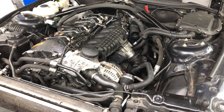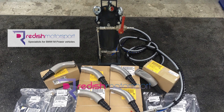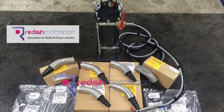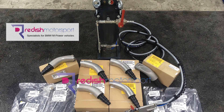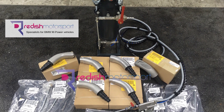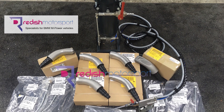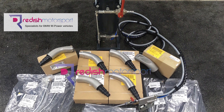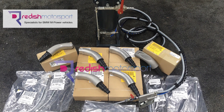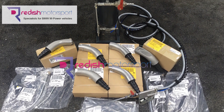We've got the complete tool set — the BMW hopper and all the correct adapters, the vacuum adapters and the pressure input tubes, whether it be petrol or diesel. So if you've got any BMW related engine like an N53, N54, N55, S55, then V8 like the N63, S63, and even 12 cylinder like the N73, then on to the new generation B-series engines — the B38, B48, B58, and the S58 — they're going to be the same because they're high pressure fuel injection systems. For diesels, we've got all the adapters: old M47s, then the N47, old M57s, then the newer N57, and all the new B-series generation diesel engines like the B37, B47 and B57.